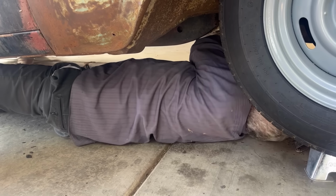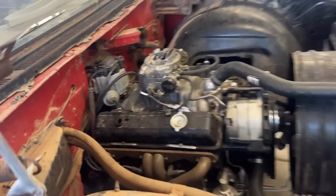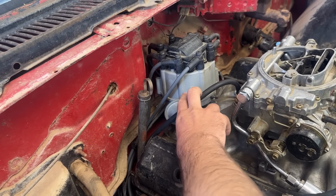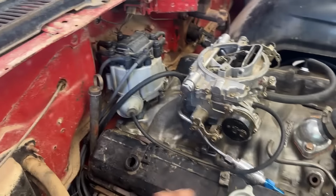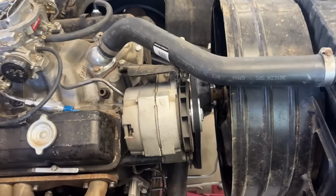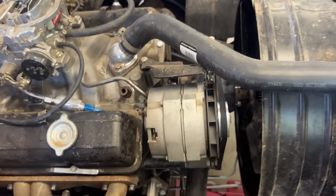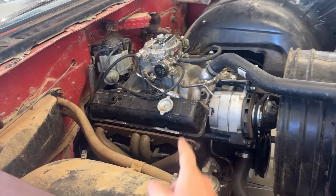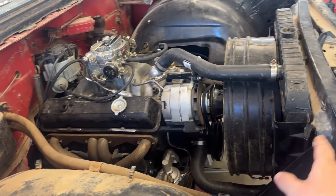So Dad's under the car right now, tightening up the torque converter bolts, and we put a couple hoses on. We connected the vacuum on the back of the transmission for the gear shift and up to the manifold, connected the vacuum advance, PCV. Now what I'm gonna do is tighten up this alternator belt and just keep working through the little details. We still gotta put oil in it, tranny fluid, water in it.